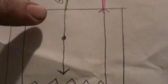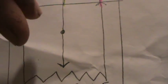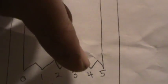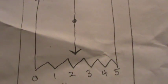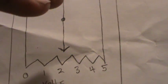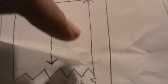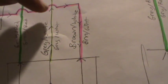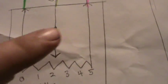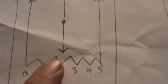And then this right here is the signal wire. Basically, this wiper moves — if it's a throttle position sensor, when you move the throttle it's going to move that wiper across this resistor anywhere between about 0.5 to 4.5 volts. So when you're sitting at idle, the wiper is going to be moved down here and you're going to read about 0.5 volts. Then you open the throttle and it opens up and it's going to read up to about 4.5 volts. So you've got the power — 5 volts being sent from the computer — it comes across this resistor and then it loses voltage: it's 5, then 4, then 3, then 2, then 1. It drops its voltage through this resistor and then goes to its ground.